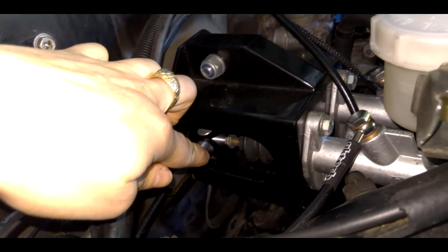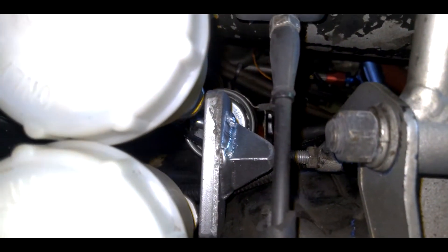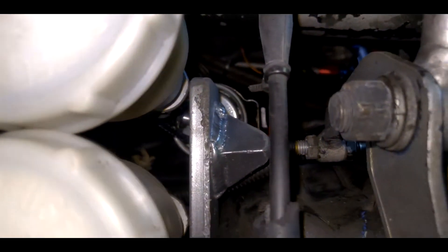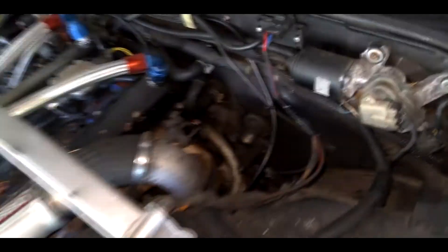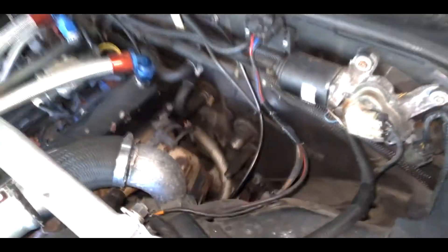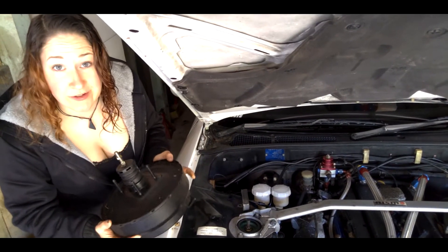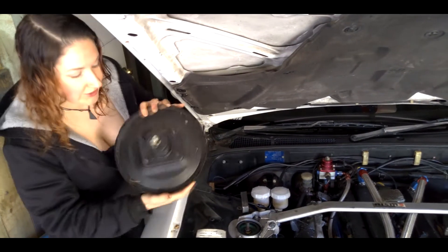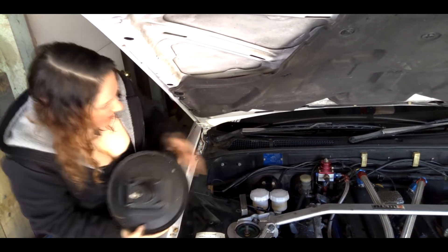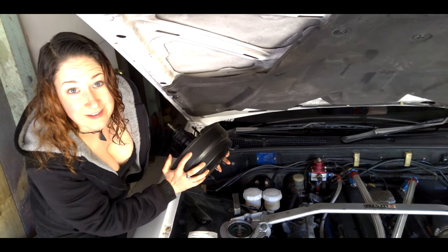In addition to the washers inside the comp brake pedal box to prevent binding, another thing they are renowned for is flex. What we've done to address that is removed the ability for it to flex — you can kind of see and get the gist of what we did there. Also, can you guys tell what's missing? It's our ABS — it's been completely removed and now we have a lot more space in the engine bay. Here's what was in there before, and here's what we've got right now with our pedal box, just to give you an idea of spacing and size comparison.